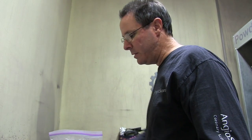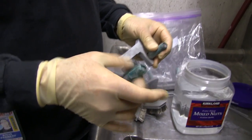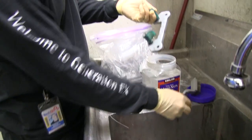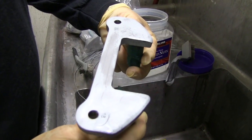I'm going to be powder coating my brake calipers. When I sandblasted the floating sliders from my caliper, I covered them with high temp tape — I don't want to sandblast the highly polished surface underneath there. The reason I use acetone is look how fast it evaporates; it leaves nothing behind.